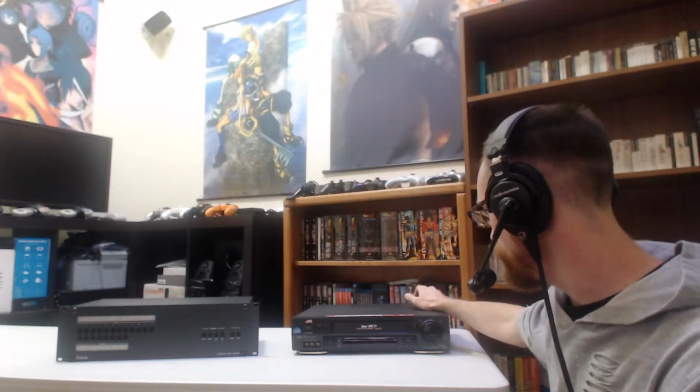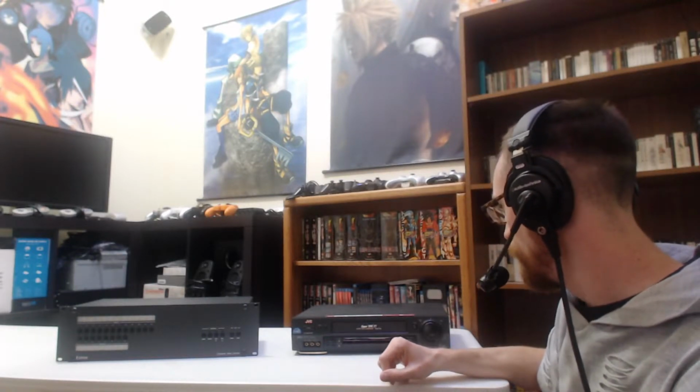So you can use these to be lagless, and then if you use something like coax to connect it to your TV, then you can run the S-Video out to your capture card, like the Elgato HD, to capture older retro games. And we'll talk about capture cards in the next video. But anyway, you could use something like the Elgato HD to capture that, or you can use the FrameMeister patch through to something else.